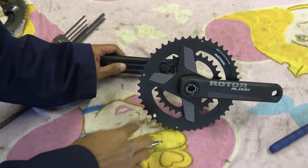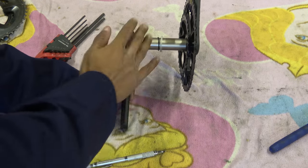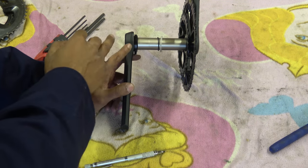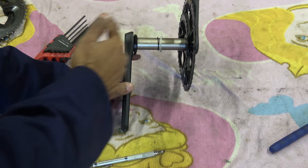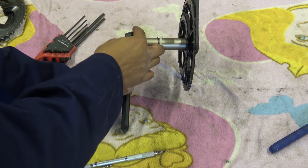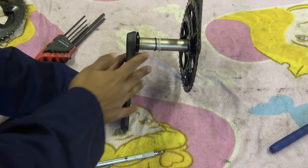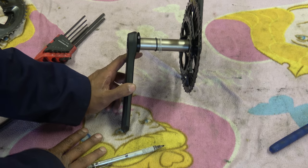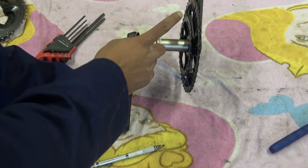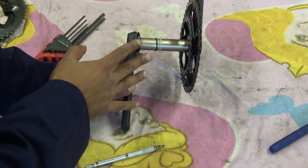What I've done here is just bolted it up so you can see how it is once it's fixed. That's effectively the centre spindle. The distance between crank arms is about 92 to 92.5 millimeters. These things are on tapers, so as you tighten, it will draw up the taper a bit more. On one side it's fixed so you've got a limit; on the other side you can keep going. The preload collar goes there and you've got plenty of adjustment. The spacers and o-rings come with it. The instructions, I will say, are pretty diabolical — those that came with this one were written for the 30mm option, whereas this is obviously the 24mm with a steel axle. But overall, as a piece of mechanics, this is pretty good — it's very good.